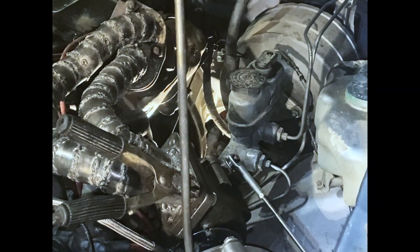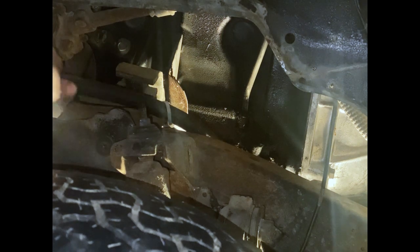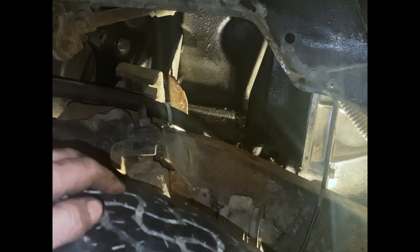See that down there? Yeah, right way down there. That little hole should give me plenty of room for a downpipe. Can you tell what I did there? Zip tie around the hose, and then from that zip tie, another zip tie, to make sure you're not putting too much stress on the hose. It's good practice.